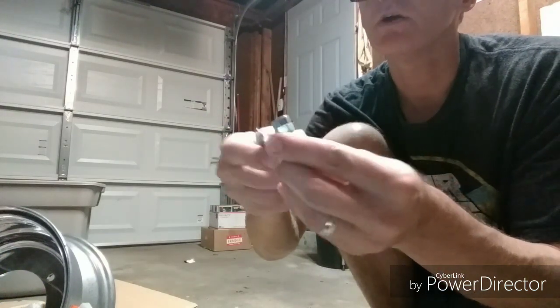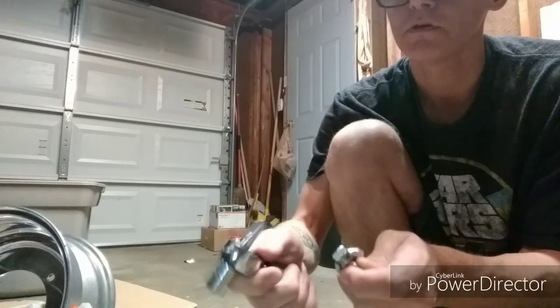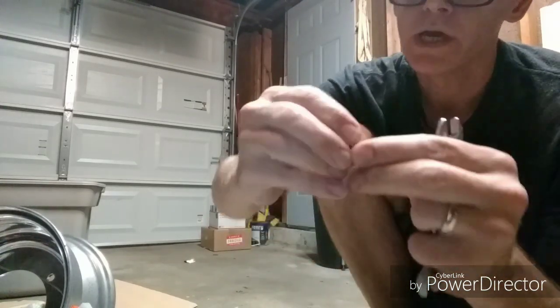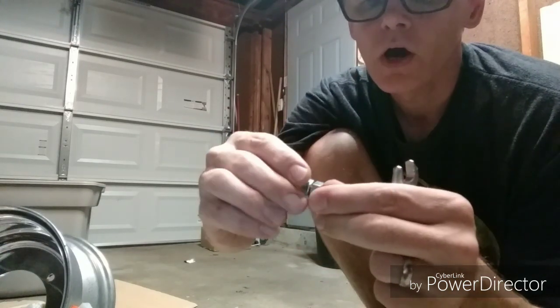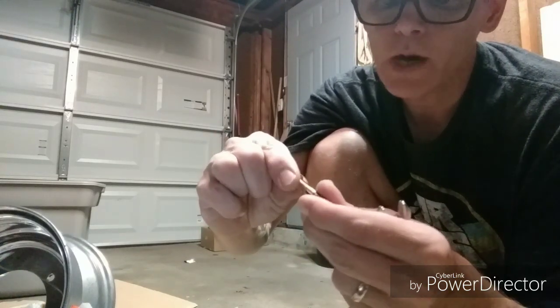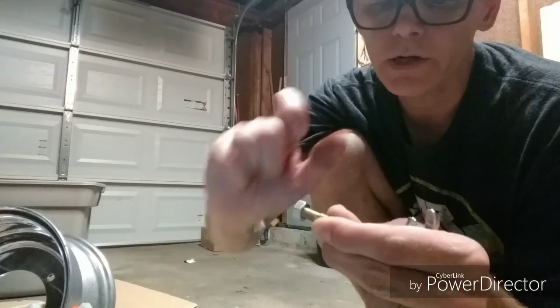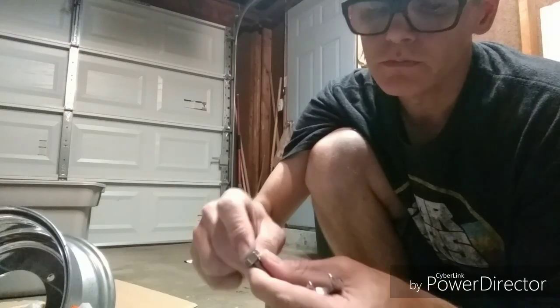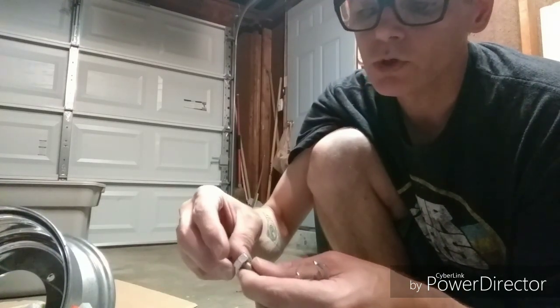Then all I've got to do to get that off is get one on there and just separate those a little bit. Hopefully the video at Home Depot came out. These move really nice on there. When you go to pick out the right nuts, there was a 5/16 nut that would go on about that much and then it felt really hard — and sometimes that's just how nuts are, but sometimes you can tell it's more force than you'd like. So keep looking for the right nut. This is metric. Most of the stuff coming over from Japan and China is going to be metric. If you find yourself in the non-metric section and you're putting a bolt on and it doesn't quite feel right, look a little longer.